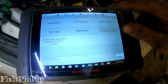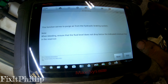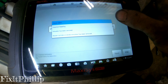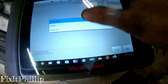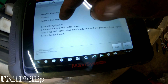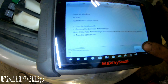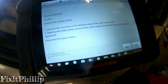I've got the ignition on. I'm going to go to air bleeding — we're going to do usual air bleeding, all lines. There are also two ABS motor relays located over here. I took those out already — they're the two blue ones. So you take those out and then hit next.